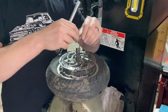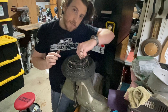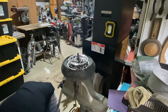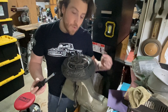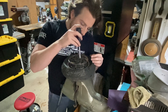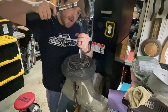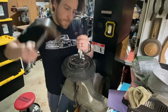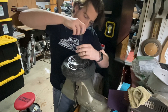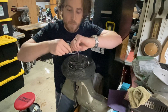All right, there's that one. So this allen head screw right here — this is the right allen wrench for it and it's spinning in there freely. One trick that you can do is take a torx bit. For this one to match up it would be a T25, but what I have here is a T27, so I can get the tip of it in just barely — just the tip — and now we're just going to hammer it down a little bit. It's creating its own grooves in here and then we got to twist. It's probably one of the easiest ways to get out a stuck allen key.